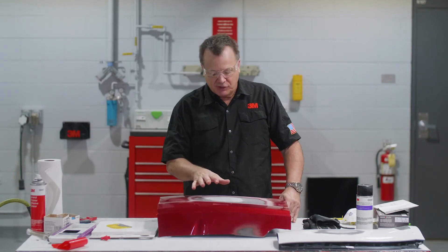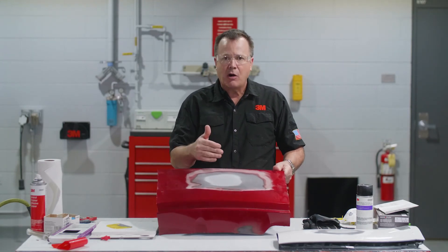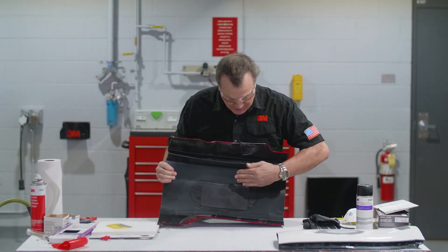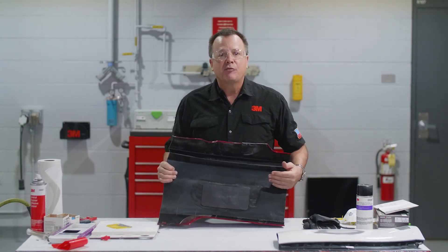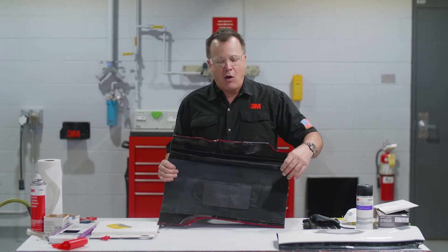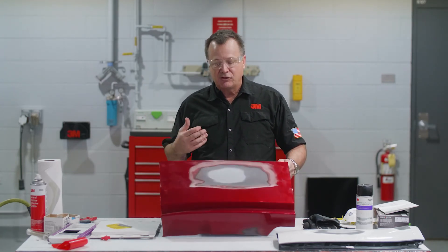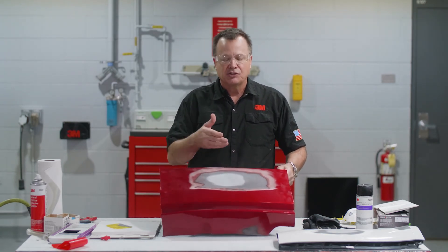We're back. I gave this enough time to set up and sanded it. There's a little fine sanding left to do, but for the most part it's ready to go. No pinholes - looks real good. The backside with our patch looks nice and neat. It looks a little neater than the adhesive patch. I think of it as just another tool in the toolbox for plastic repair. One other thing to mention: always consult the OEM information for any guidance they may offer on these repairs. Keep in mind some vehicles may have sensors behind the bumper where the manufacturer may have restrictions on what can or cannot be repaired. So always look up those OEM recommendations every time you make a repair. Thanks so much for joining us. If you have any comments or questions, leave them below. Hit that subscribe button and ding the notification bell. For more content like this, look us up at 3mcollisionacademy.com.